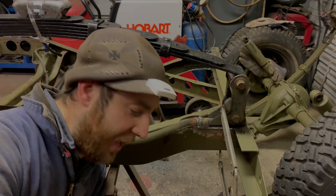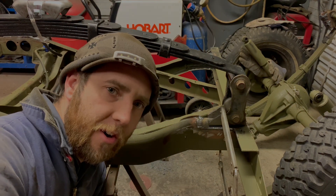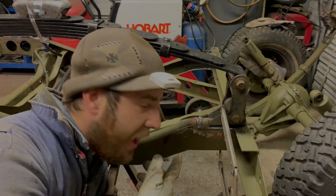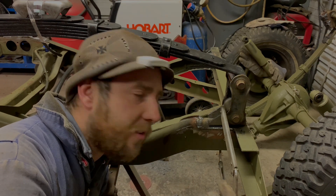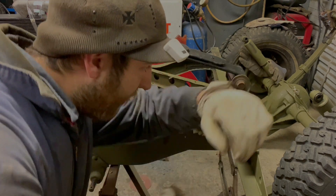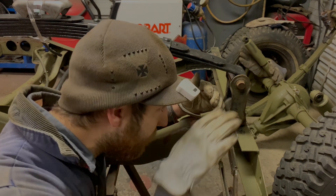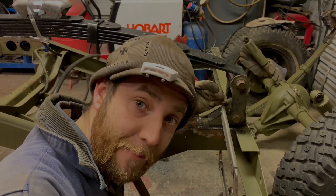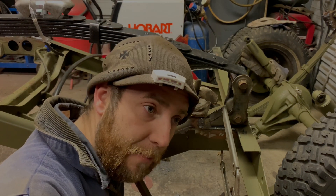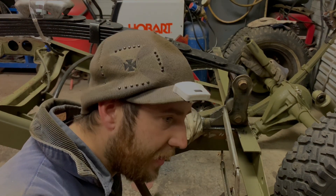I almost just gave myself a royal screwing. I was measuring out the rear of my wife's 95 YJ for the shackle location — it's a factory YJ spring — and I noticed it was a little bit longer. Then it hit me: with no weight on it, the shackle should be 45 degrees or more forward, and when loaded it should be 45 degrees or more the other way. I was setting it up in the middle, which would mean with weight on it, it would barely move and kick the wrong way.